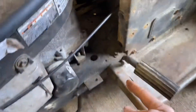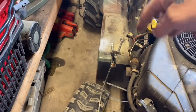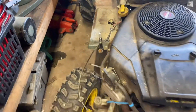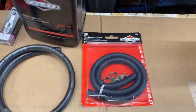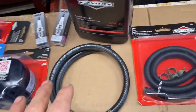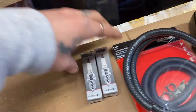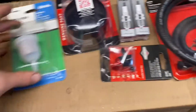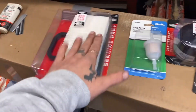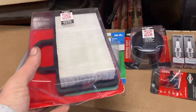So what I'm about to do is change the air filter, change the spark plugs, oil filter, and the oil. I'm also going to do new fuel line, new fuel filter, and a new shut-off valve. Here's what I'm using: Briggs fuel line, Briggs oil, some extra fuel line from a local parts store, new NGK plugs, Briggs oil filter, Briggs shut-off valve, a knockoff fuel filter, and a Briggs air filter. I strongly believe in using name-brand oil and air filters — for the extra two dollars, it's so worth it to buy the exact fit.